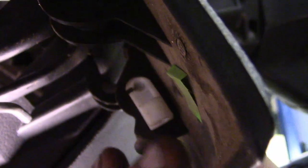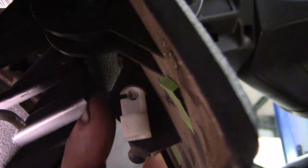Here's the back side of the emergency brake release handle — this is the piece I just took loose. The rod, which is right here, has a little hook on it. The hook goes inside the hole on the white piece. What you do is rotate the white piece up until it locks onto the rod. What we're doing is pulling and spreading the ends apart up top and pulling it off, then pulling the rod out and letting it come back. Now we've got it loose and we can move on to the next step.